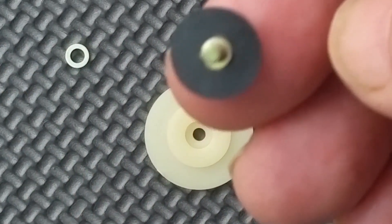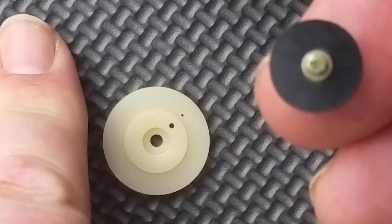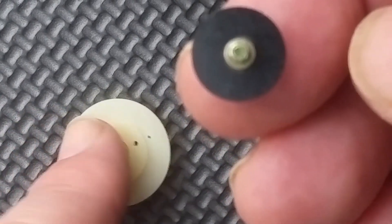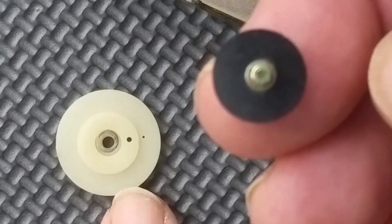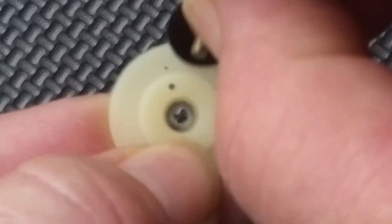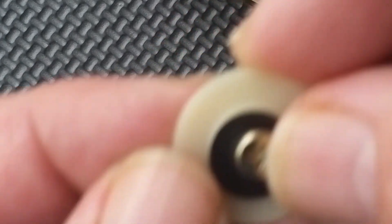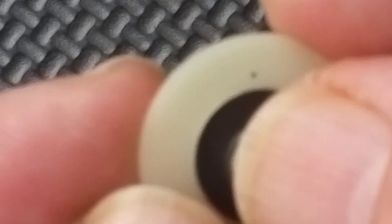When you do screw this back together, you've got to make sure that the nut is centered around the larger washer. And that little small washer has to be there. This metal washer sits inside the plate — all designed to make a valve that creates just the right pressure to act as a shock absorber. It's good, it's all nice and flat; just keep a little tension on it and screw it back in.